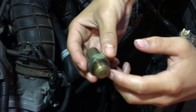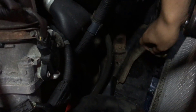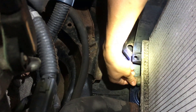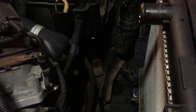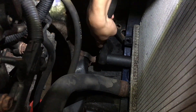There's an O-ring on the temperature sensor, so you don't have to worry about over-tightening it, just like it is with the drain plug. So screw it in as far as you can with your hands. I'm pretty sure you might not have to use a socket wrench for this, but I'm just going to use it anyway to make sure it's in. I shouldn't have to tighten it that much, especially since you don't have to over-torque it because of the O-ring. All right, so it's already tight.